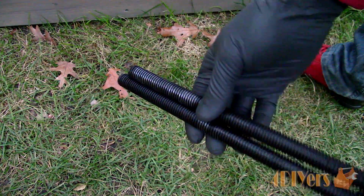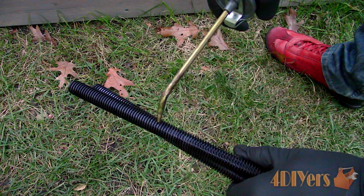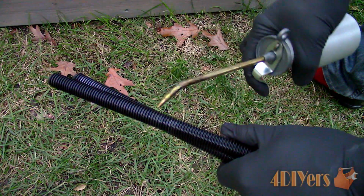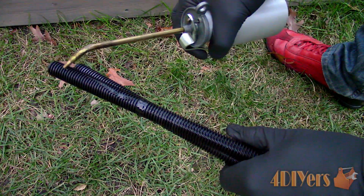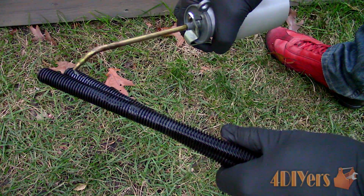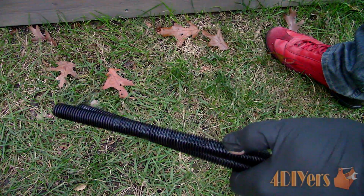It's unsafe, and if it lets go, it can cause you to lose control and create an accident. Now for breaking down the strut assembly, we'll need a spring compressor for this. You can either use your own, rent the tools from a local auto parts store, or have a mechanic do the replacement for you. I will show the full replacement here.